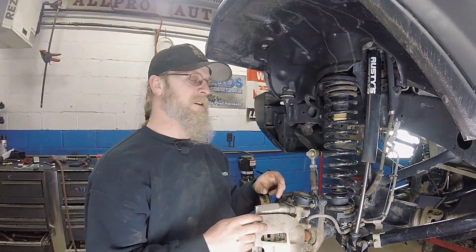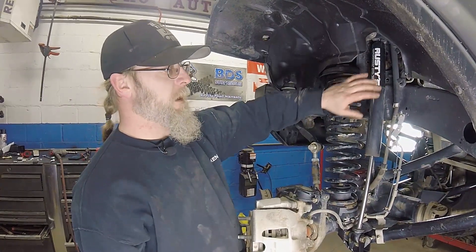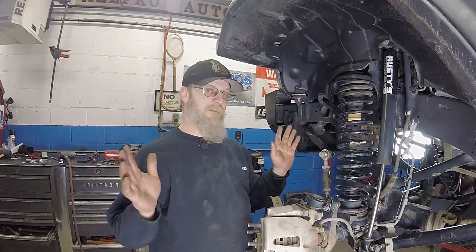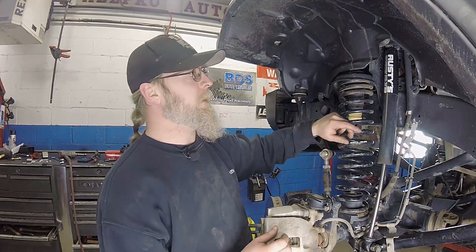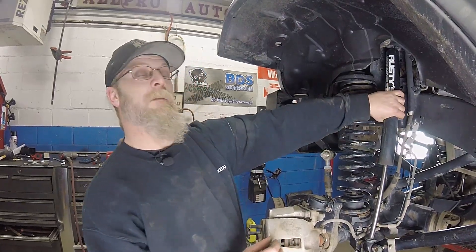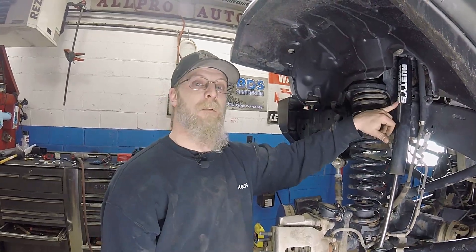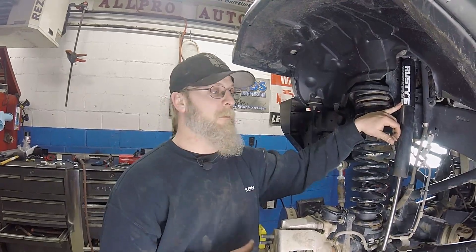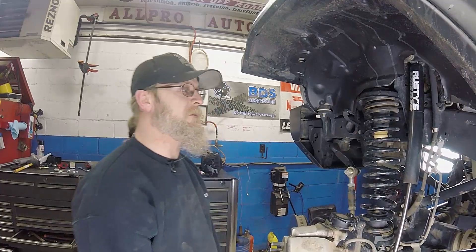For a more advanced suspension with typical bolt-on stuff, none of this is going to really matter. But we're actually starting to get to the point where we're trying to maximize suspension travel — not trying to build some big Jeep on 40s to conquer the world, just trying to maximize what we've got without going broke. We might eventually run some RX 900 remote reservoir shocks in the front of this. They're not too hard to package in the front but really tough to package in the rear. This helped us gain clearance for the bracketry to mount a remote reservoir.